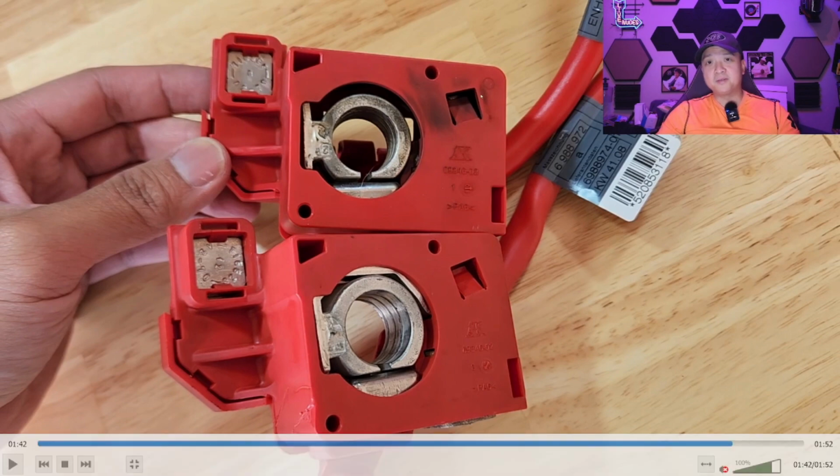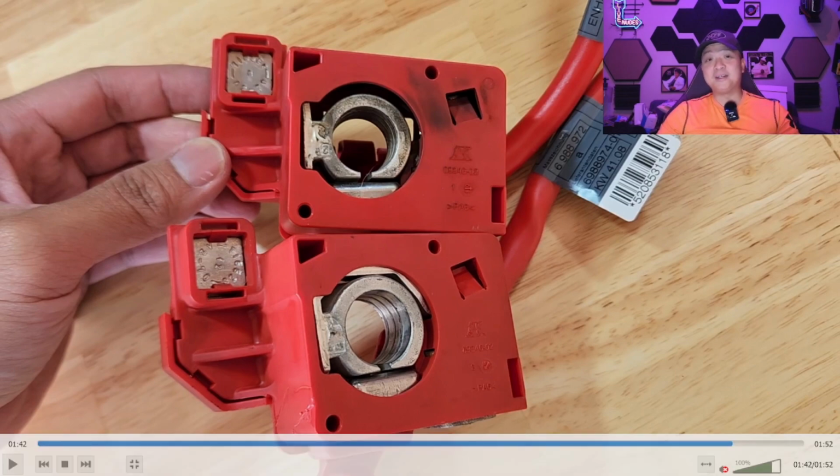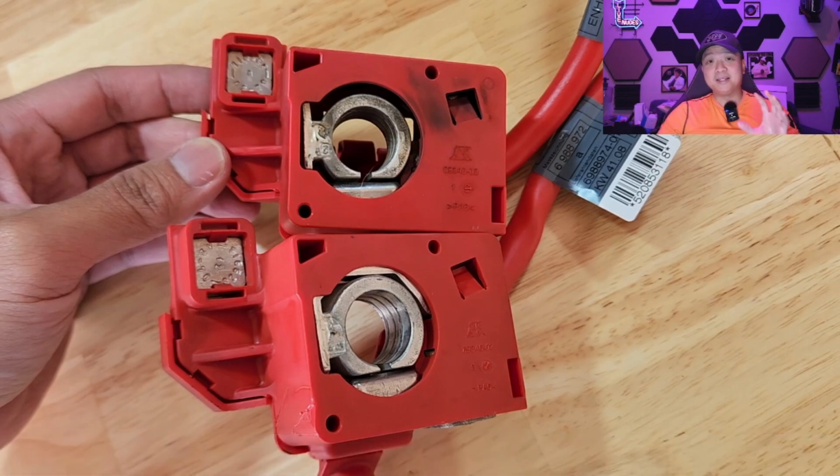Over here, you don't see it. And plus you see some charred residue here from that physical explosion that happened. So when your airbags deploy, the little mini explosion here pops that cable up towards that direction, so therefore that connection is severed. So this is the main reason why your car will not start after an accident. It's this cable, it's severed.